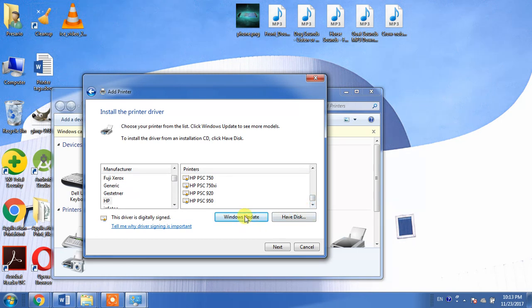From here you can search for HP LaserJet 3050. If you do not find this driver in the list, you can hit the Windows Update button. It will take a few minutes and your list will be updated. After that you will be able to see the HP LaserJet 3050 in the list. When your list is finally updated, select the manufacturing company HP and then search for the printer.